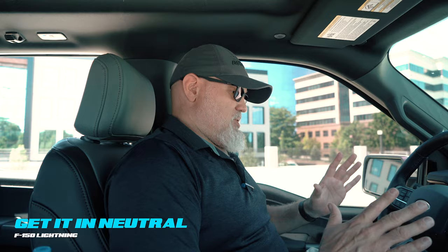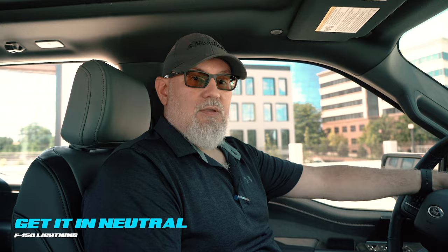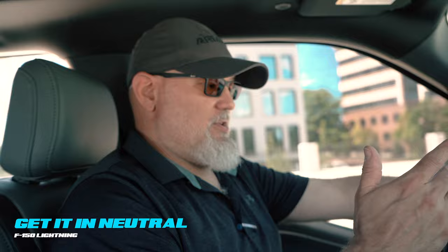The next method: if for some reason you don't have a green ready light in the dash cluster, put your foot all the way down on the brake and all the way down on the gas — that will unlock this shifter. Bring it back into neutral and press the neutral hold button twice. You'll see 30-minute neutral mode enabled. The easiest, most direct route: with the key fob present, put your foot on the brake and press the start-stop button. You'll get a green ready light. Shift the vehicle into neutral, press the neutral hold button twice — 30-minute neutral mode enabled. Load it onto the carrier.